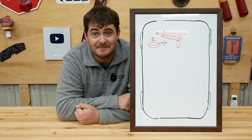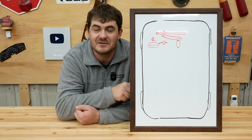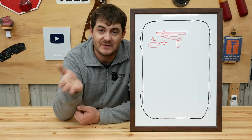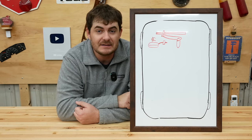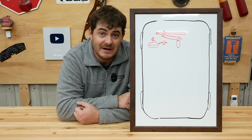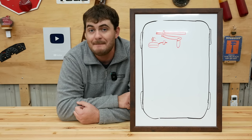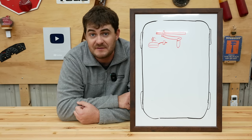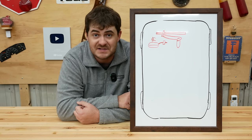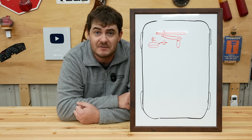Job done. With the power steering, a common approach is to take the electric power steering column out of a Prius and throw that in there because that goes in with minimal effort. But I'm going to try something a little bit different. I'm going to leave the hydraulic power steering rack in the Escape as is, untouched, and replace the belt-driven hydraulic pump with one that's driven by an electric motor. This is referred to as electro-hydraulic power steering, and I did a quick search on eBay and found loads of those pumps for pretty cheap, so this seems like the path of least resistance.